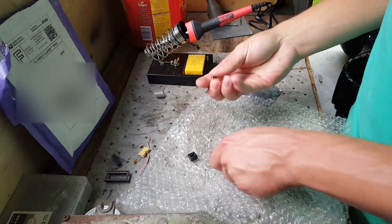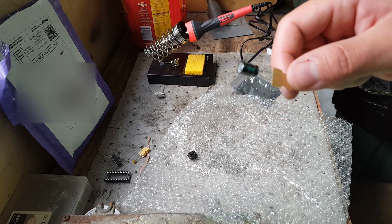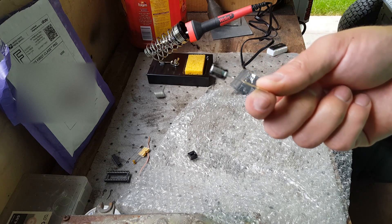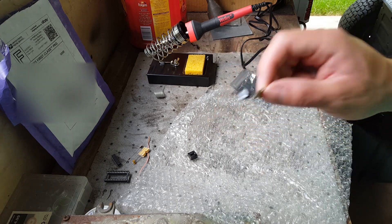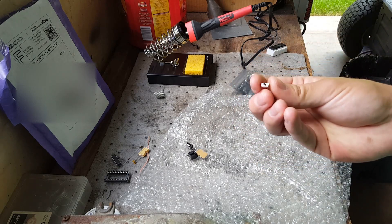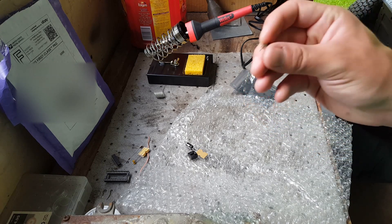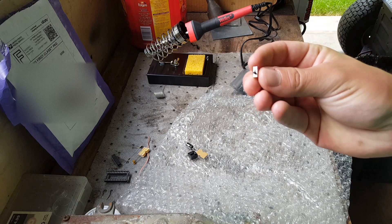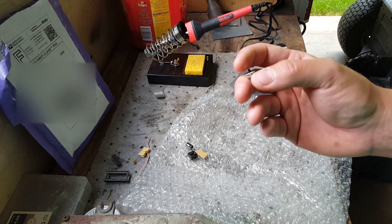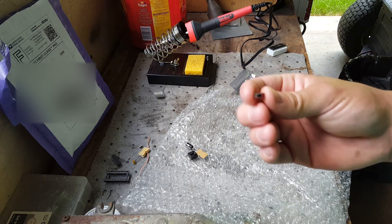Just a quick update — I did find out what these are for. This is actually the main capacitor for the ECU. They give it to you because it's a good idea to replace it so that you don't have capacitor failure, because they are really old. And then this switch is for J1, which is normally where you solder a wire — that makes it so that it uses the chip's tune rather than the board's. This switch you can put there instead of a wire, and then you can turn the tune on and off by flipping the switch, so you can go back to the stock board map if you'd like.